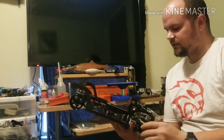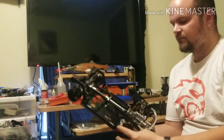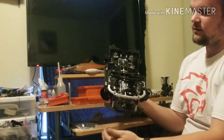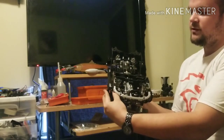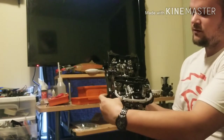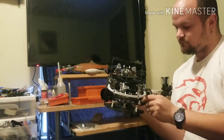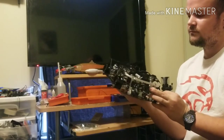The Ackerman setup isn't all that great because if you actually look down at a real car, the outside tire — if I'm turning left right now, the outside tire which is this one is having to go around a bigger circle. So it should be about like that, while the inside wheel has to go around a smaller circle so it's supposed to be pointed a little more. So yeah, the Ackerman setup's a little off.